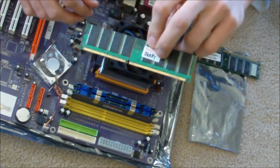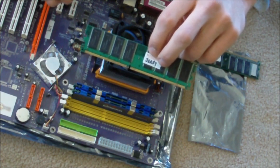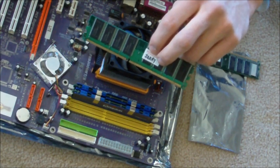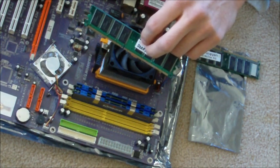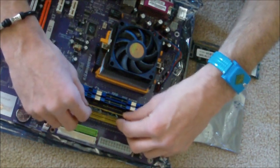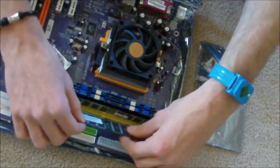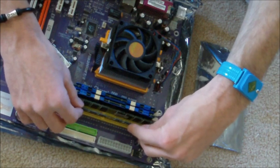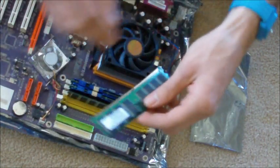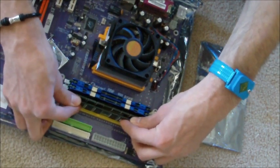For this case I have different brands of RAM — generally you don't want to mix brands. You want to get all the exact same sticks of RAM to make sure it's all compatible. But I already know these work okay together. Also, I want to mention this thing I'm wearing on my wrist — it's metal on the bottom and basically keeps me grounded so I don't shock anything. One thing to note about motherboards: I had four sticks of memory and four lanes. Some cheaper motherboards only have two lanes, so keep that in consideration when shopping for your motherboard.